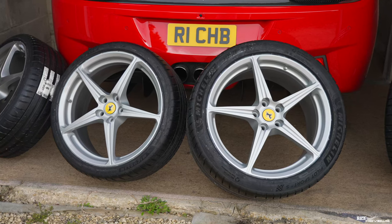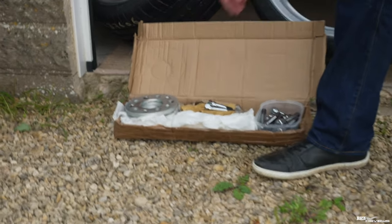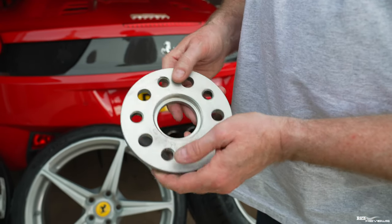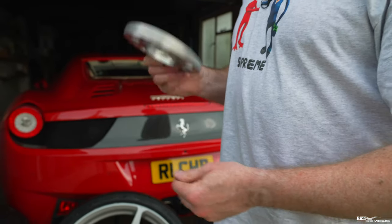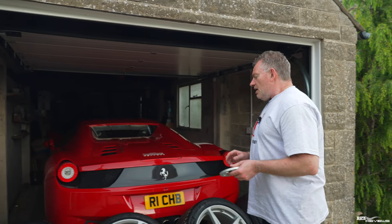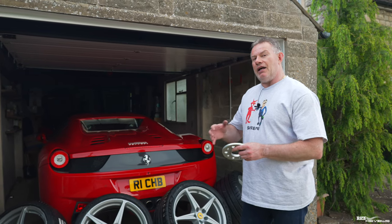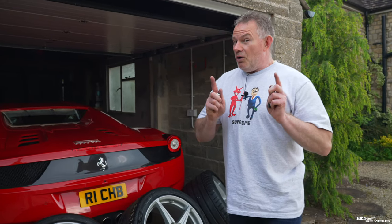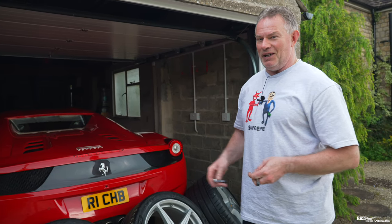By way of magic, we have the wheels back. A friend called Martin has kindly provided spacers he used on his 458 Italia — these are approximately 12 millimetre spacers, which will push the wheels out slightly and fill the arches a little more. We're putting these spacers on all four wheels. We've also got wider 245 tyres going on the front instead of the standard 235s, so combined they should fill the arches nicely. Of course, if you're using spacers you need longer bolts — otherwise you're into serious trouble with the wheels potentially coming off.